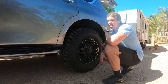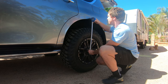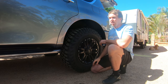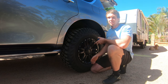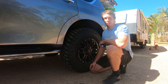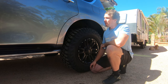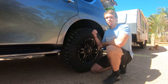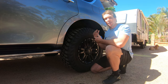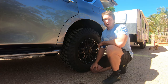We've inflated the airbags up to 60 PSI — as you can see, it's definitely brought it back up. So it's 597mm. Originally we had unloaded at 6 PSI: 601mm. With the load on and airbags inflated: 597mm. So we've got a total sag of 4mm. We've got about 160-170 kilo ball weight with the caravan fully empty — no water, no gear on board. I'm absolutely stoked with that. We do have 200-kilo heavy duty springs in here to cover the load of our drawers, batteries, fridge, and all our recovery gear. I'm stoked with this — it's looking pretty damn level.